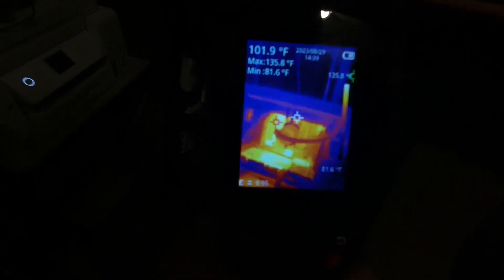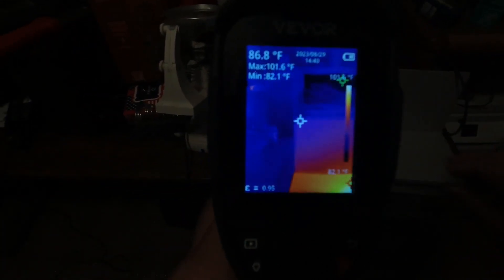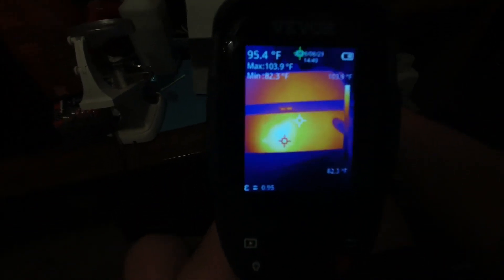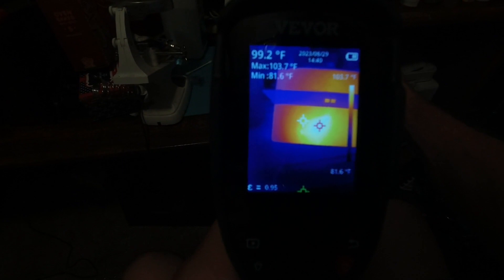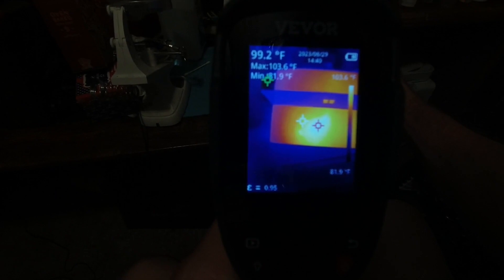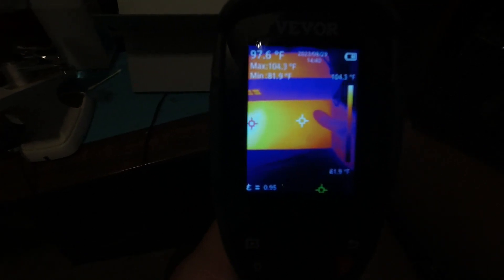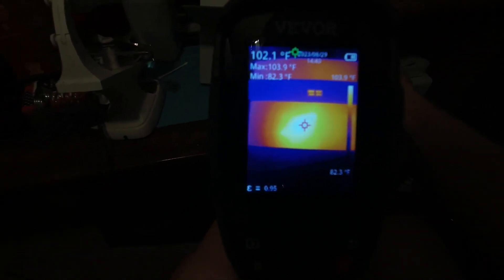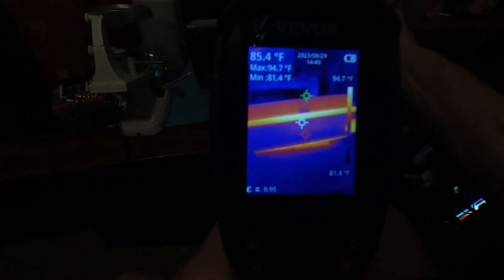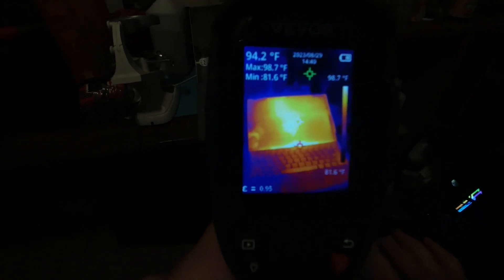Let's take a look at this little Microsoft Surface tablet. I'm going to flip it over — this has the stand on the back so it kind of sticks out like a fin. But as you can see, there is one spot on the back of this that gets pretty hot. It's about 100 degrees Fahrenheit right now; my maximum hot spot is 103. Definitely see what spots are getting hot when you have a visual heat map like this — I find that just extremely useful.